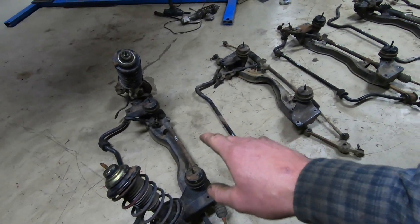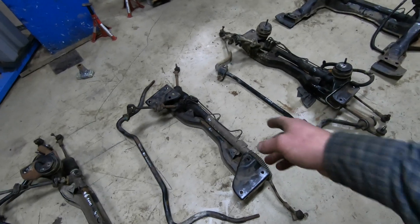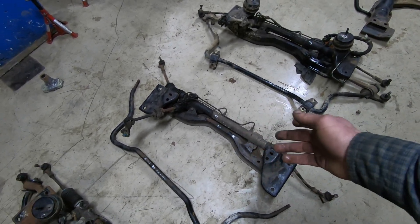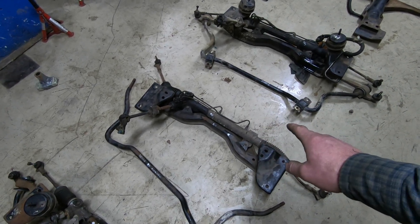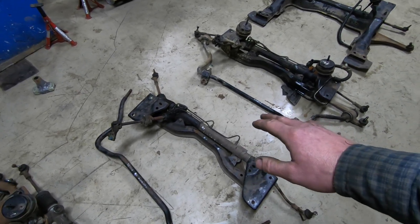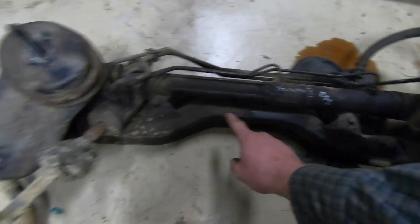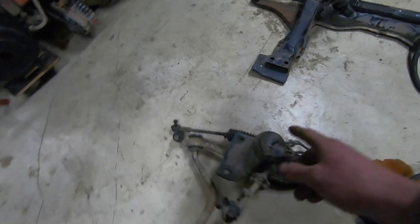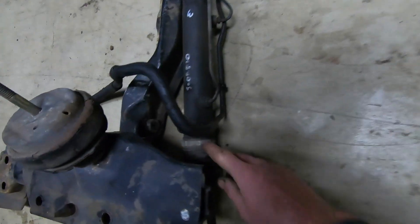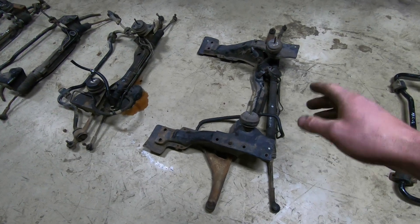Another thing: if you're thinking about swapping any of these, keep in mind that if you swap a manual steering rack for a servo-assisted one, you have to have the servo system. You cannot just unplug it and expect it to run because the seals will get damaged, and overall it's just bad for the rack. If you were to use it without power steering you'd have to fill it with some kind of lubricant - but that's a whole other story. I think you could use the Scorpio servo rack on a Sierra because the holes line up perfectly, though it's a bit wider so you'd have to sort out the tie ends. On the Scorpio Cosworth the mounting points are horizontally mounted so it won't fit the Sierra unless you use the whole subframe - if you're considering that, watch the subframe video as well.